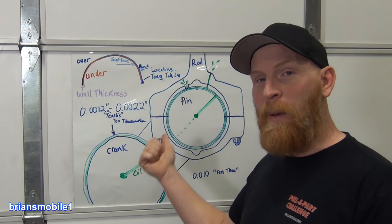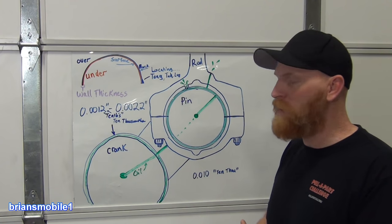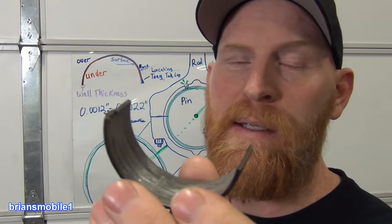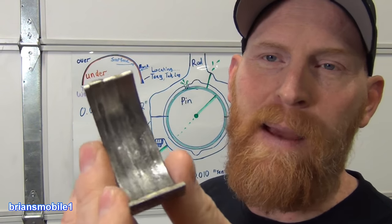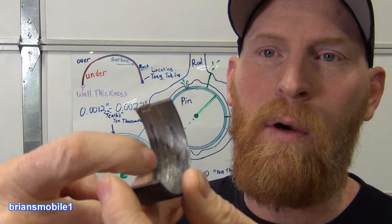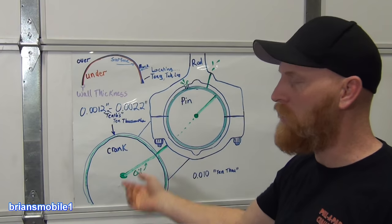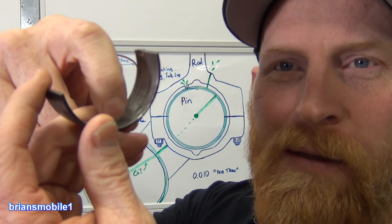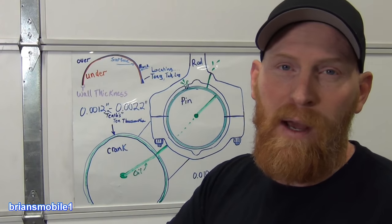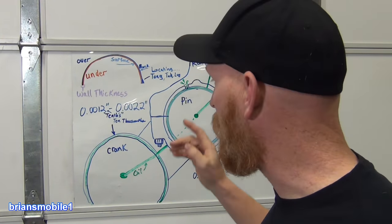This is a confusing topic just on its own — the terminology can be confusing. The number one thing is what bearings are, and that is: a fuse. This is a rod bearing, and it's damaged. You can tell by running your fingernail across it — give it a fingernail test — on your crank, the surfaces inside your connecting rod, the caps, or the engine block. If you run your fingernail across it and it's not smooth, it gives you a chill like nails on a chalkboard. If it does that, you need to do something about it, otherwise you'll have premature failure or immediate failure.